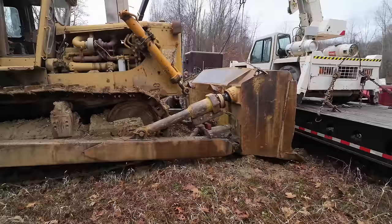So Gino, have you ever bump started this before? Honestly, yeah. We had to do it in Nashville one time. The starter went out of it again, and apparently today is the day for another one. I've never bump started a Peterbilt, so this is exciting for me. Hey, don't shut it off anymore, because I can't pull you once you put a D9 on it. You could definitely pull start it with a 9 on. That worked pretty well. I really couldn't complain about that. Good thing you brought your Ford starter for your Peterbilt, you know?